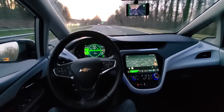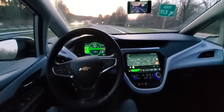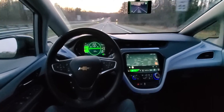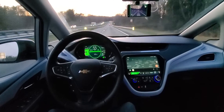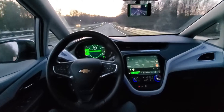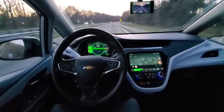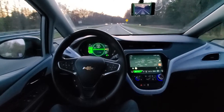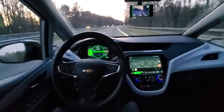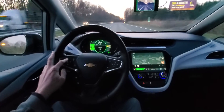My commute home is only about 14 miles, which makes it a little bit easier. With the install, it's simple — just unplug the OEM camera, plug it into the giraffe, plug the other side of the giraffe back into the OEM camera. I've got a gray panda connected to the OBD port on the giraffe, and then the GPS is located up there in the red PETG housing.